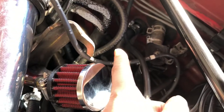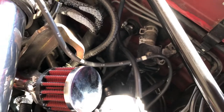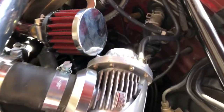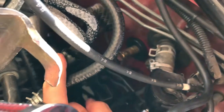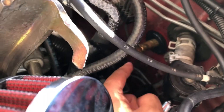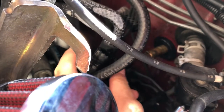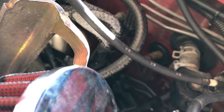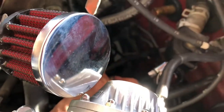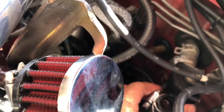I'm going to loosen these clamps and take out these two hoses, measure what size they are, and buy the hoses or connector from Home Depot. About five minutes later I got both hoses out. One of them is really hard to get off — you might need a flathead or pliers to help pull it out. Be careful not to damage it because these hoses are discontinued, so you'd probably want a universal S-hose.